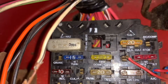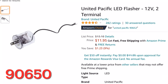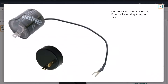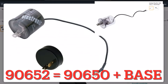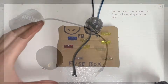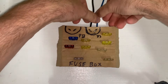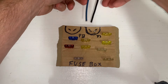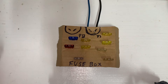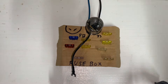However, if you want to try to save a couple dollars and predetermine your polarity requirement, United Pacific 90650 does not include the base. 90652 is actually just 90650 plus a base — the base costs a couple extra dollars. Another option, if you're having polarity issues or trying to save a couple dollars, is to rewire the back of the fuse box to match the polarity of your flasher. But in my personal opinion, the base is worth it to ensure that polarity will not be an issue if you are uncertain.